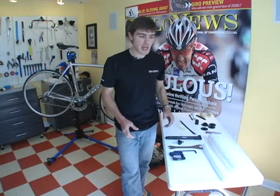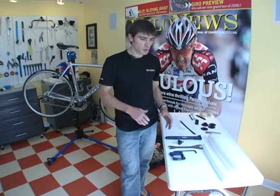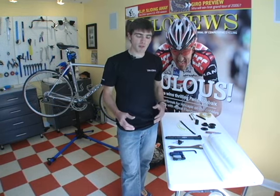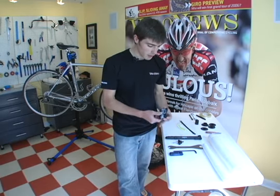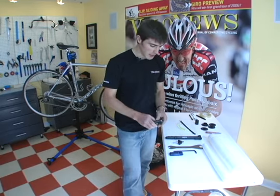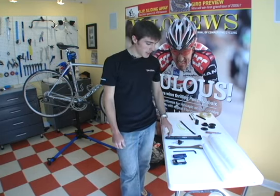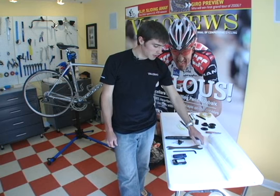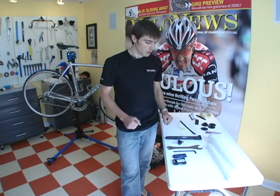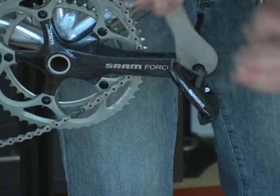Generally if it's the first time for you to pack your bike, you're going to want to do it with the tools you're going to be traveling with, just to make sure that you have everything when you get to your destination. You can do it with a mini tool — this one's from Pedro's, it's got a whole bunch of Allen keys and whatnot on it. Park does one too. The one consideration you want to take in terms of using a mini tool is your pedals, as those get pretty well torqued on and you may need a longer Allen wrench that you can get some more leverage on.